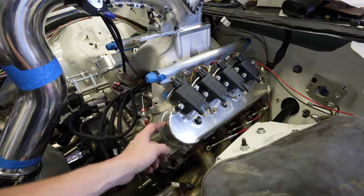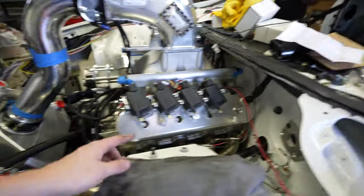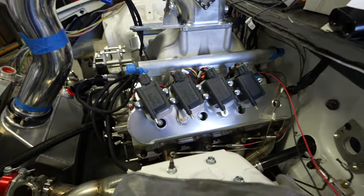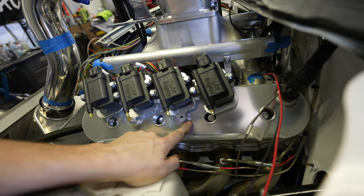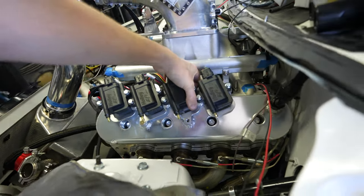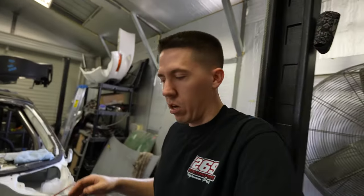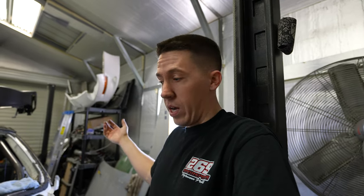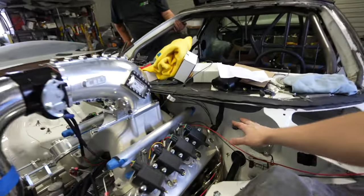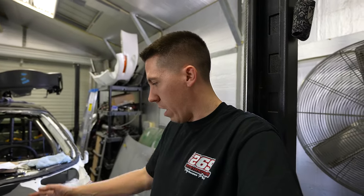I also got these fab aluminum valve covers — a new set because the other ones had the wrong fittings. They also have universal coil mounts, but I actually ended up cutting those tabs off and making one tab on the back, welding little mounts on. I got some mounts off of eBay and these will sit just right there, which allows me to mount the new Holley Smart coils on the valve covers. There wasn't a perfect bolt-in option for the height of the rockers in these heads, so I just bought a bare set, modified them, and made them what I wanted.